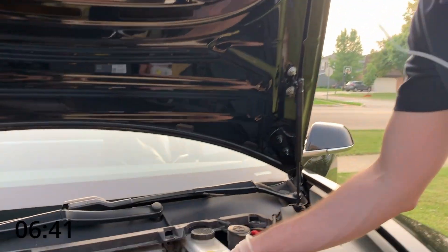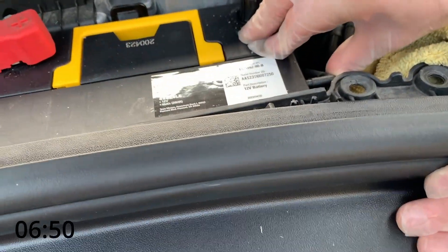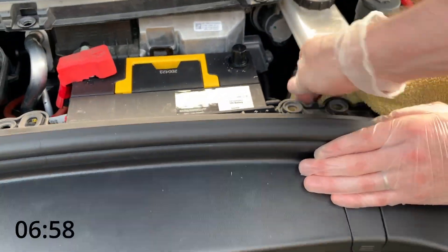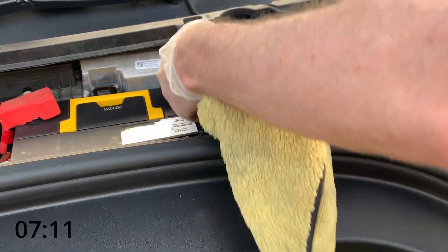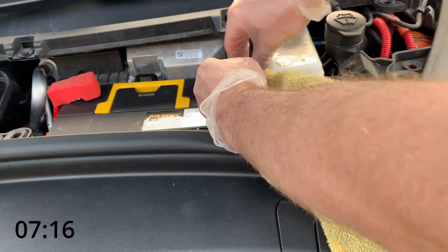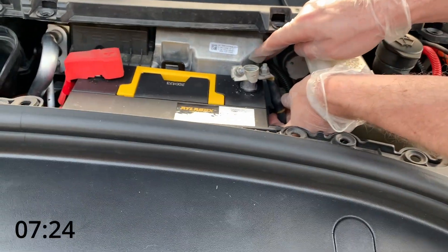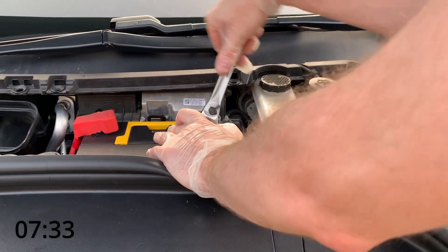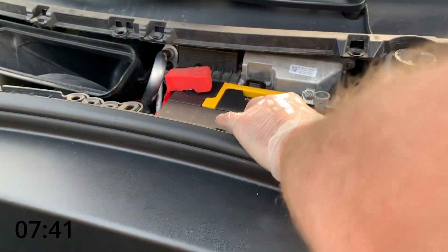Next step is to put the air hose back on the air vent — find the little hole and push it in just the same as it was before. Push it in as far as it'll go. Once you've got that in, remove the plastic cap from the negative terminal. Very carefully bring the negative terminal back up into this area. The minute you plug it in the battery is going to be live again, so do this quickly — don't touch any metal parts, slide it down. You may see a small spark — that's normal. When the noise starts up you know you're doing something right. Tighten it down enough to make a solid connection, but don't over-tighten it.